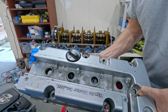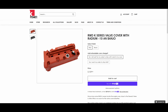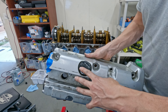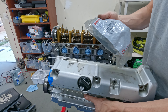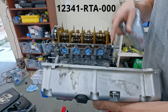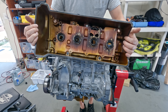For a rear-wheel-drive K-swap, you'll probably want to swap out the valve cover for something that has the breather relocated to the side. Companies like K-Power and K-Tuned offer different valve covers with various venting options. I'm going to hold off on buying mine now because I'll be taking this in and out of the car a few times and it'll probably get scraped up. When you do get one, if they don't include a gasket, here is the part number for the valve cover gasket, and these spark plug tube seals should probably be replaced as well if you're sticking with your old valve cover.